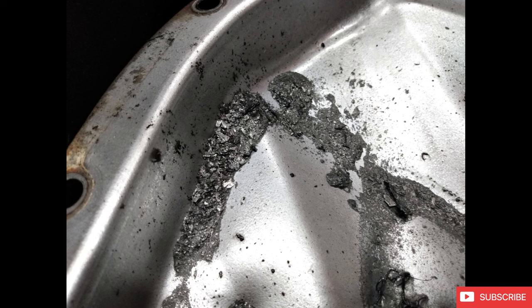As far as the engine goes, now's the time to get it dressed to go in. So you're going to want to put on the right oil pan for the application. Engine mounts, we just talked about. For the oil pan, you want a rear sump. That's used on pretty much the vast majority of LS swaps and OEM applications. I used an F-body, so a 98 to 02 Camaro pan for my swap. It fit just fine. Those are getting kind of tough to come by now, used.